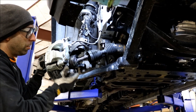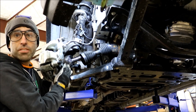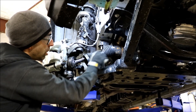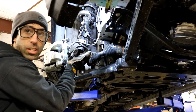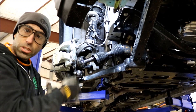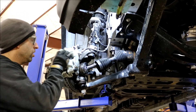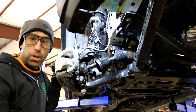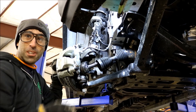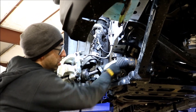A new hurdle that these all-wheel-drive Transits present is that now we have front axle shafts too. These axle shafts only have so much movement in them — only so much angle they can handle before they get bound up and start grenading themselves pretty quickly. No matter what conditions you're in, if you're driving down the road at 70 miles an hour, these are spinning at 70 miles an hour. There's a lot of load and a lot of wear happening in these joints.